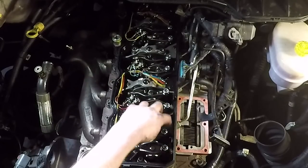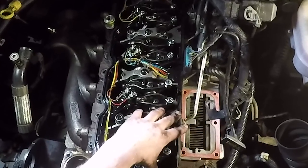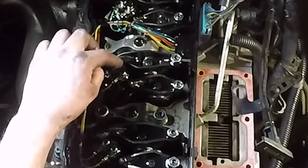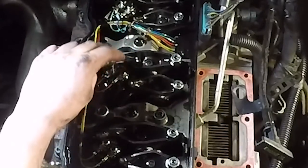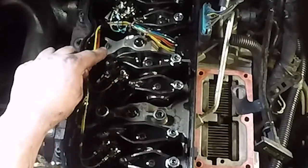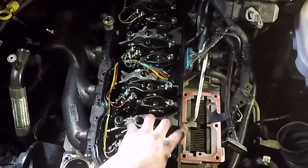Now that I think about it, we'll take this rocker box spacer plate off. One thing to note: this gasket between the valve cover and that spacer plate is also your injector wiring harness. So we want to be very careful when taking these nuts off. Coming off it's not that big a deal — they shouldn't be tight. But when you go back, it's very low inch-pound torque — you just want them snug. If you over-tighten them and snap off one of those studs, you need an injector, and that's a bad day. We're already pulling a head gasket, we don't need more issues. So we'll undo all those, pull that gasket off, pull the rocker box spacer, and then start working on our fuel rail and injector lines.